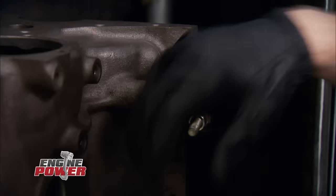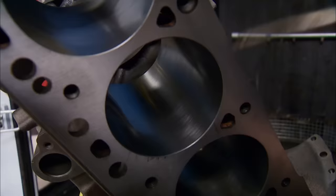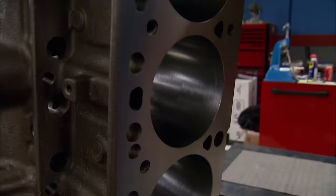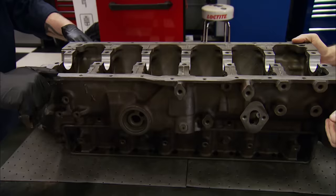The block is coming out of the washer for the final time after removing all that grinding debris. We're going to assemble this engine a little differently — no engine stand. These engines are so long and nose-heavy that they've been known to break off an engine stand. On a tight-tolerance engine, they can bow so much that it can actually lock up a crank.